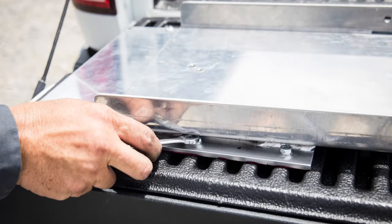Align the scribed arrow on top of the base plate with the scribed arrow on the swivel plate to allow the key on the underside of the swivel plate to drop into the key slot of the base plate. Rotate the swivel plate, placing slots over the edge of the tailgate to install the ladder.